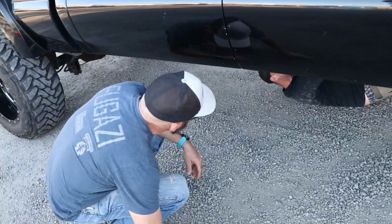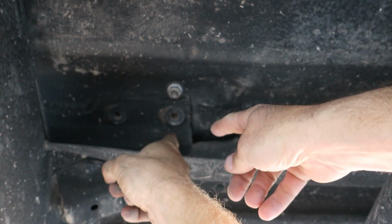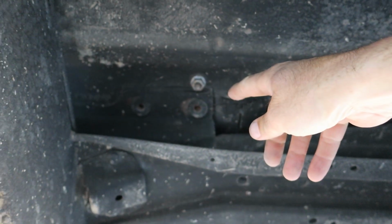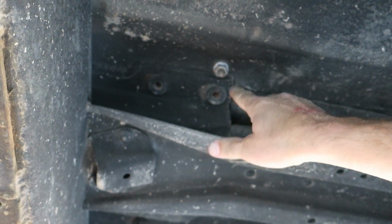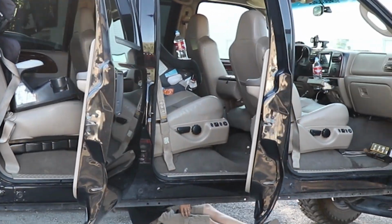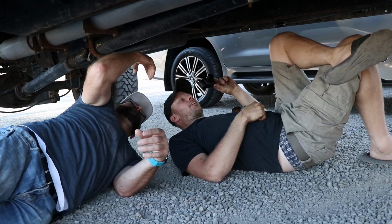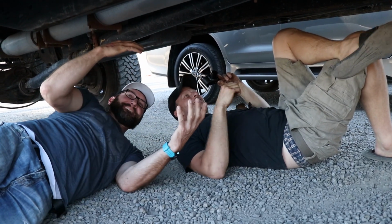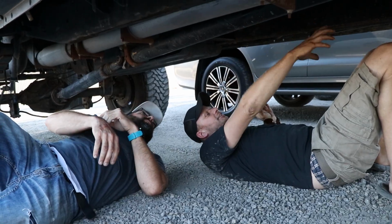Did you put a plate over top? Is this the seam right here? This was laminated. It had an extra piece right there. Okay. The back seat mounting holes were 2 inches farther forward than where they ended up, because I used front seats for the middle row. Oh, okay. So this piece here was just a cross member from the front half of the back cab. That makes sense? Yeah. Just ended up chopping it in half right there. Nice. If you look at it quick, you can't tell where anything's been done. It's really good. Nicely boxed all the way.